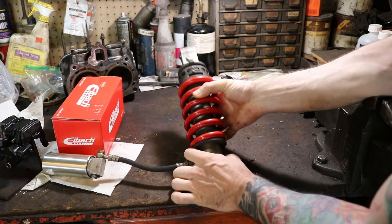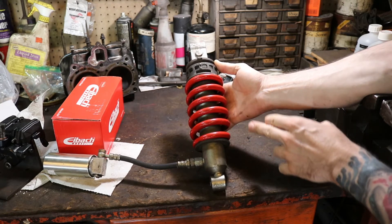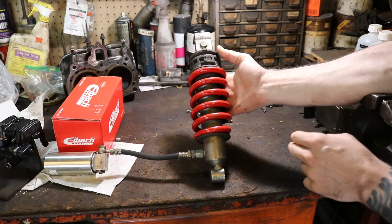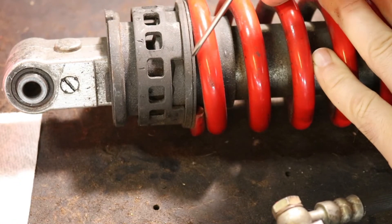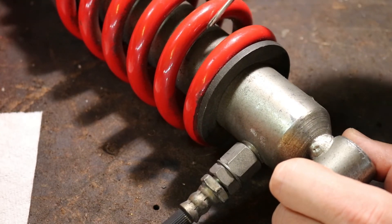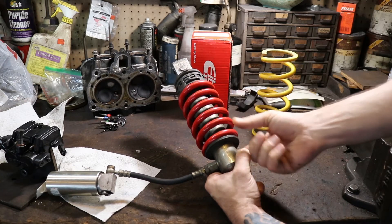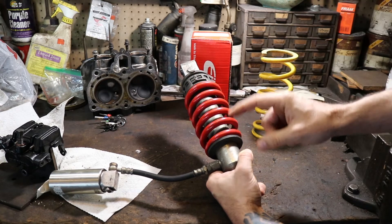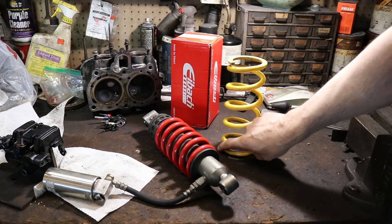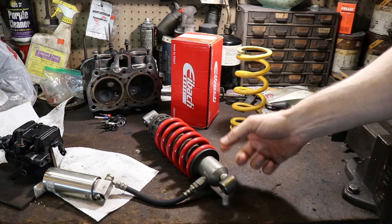On this particular shock, you might be able to tell that it's tapered — it's smaller down here than up here. One consideration is that you'd also need to get bigger collars. The collars are what the spring comes in contact with and what holds the spring onto the shock. The reason you need different collars for this tapered shock is that the coils are smaller at the bottom, so you'll need a wider collar down there. Aftermarket springs you can order are not tapered — they're straight springs, the same width top to bottom — so you'll need the wider collar on the bottom to accommodate the wider coil.